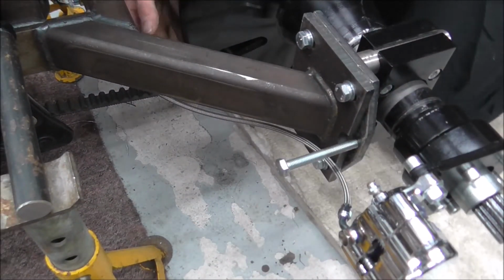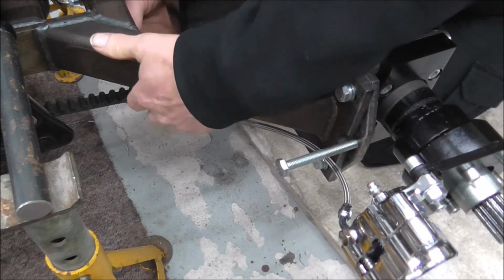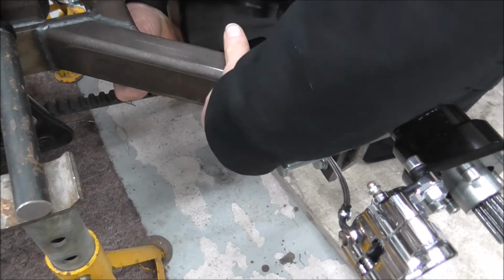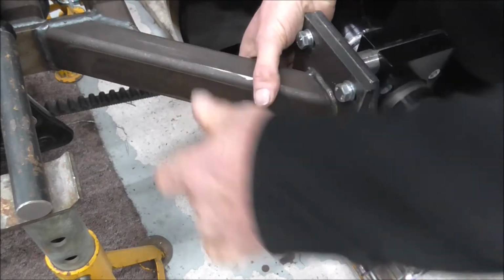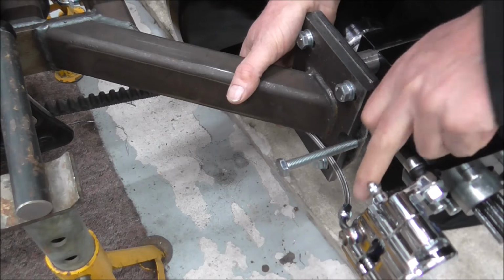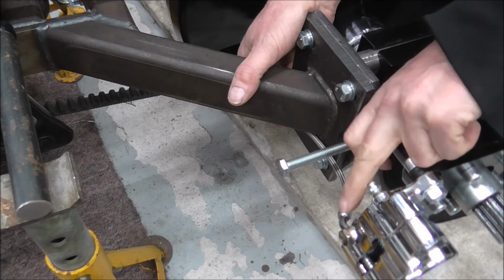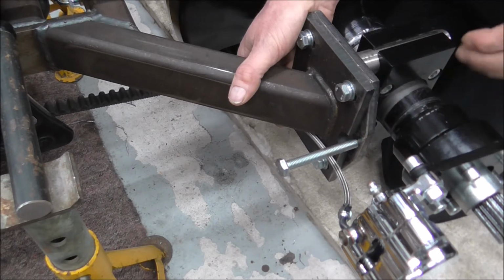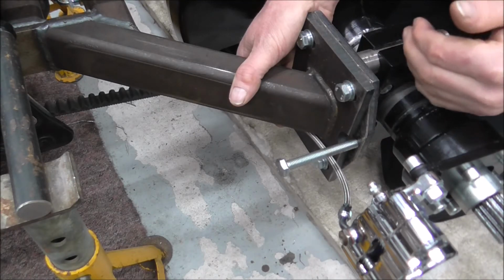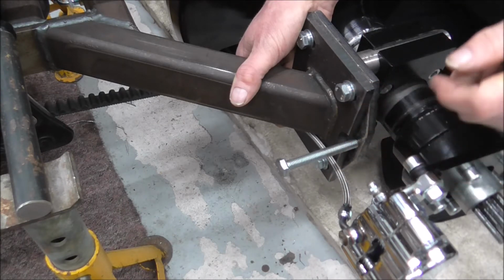So I've made up this section from the T-piece to the caliper, and basically it'll come along as I've explained, clamp up underneath with the pipe clamps, and it just nicely loops round onto this bent, so I think that's like a 45-degree banjo fitting, and bear in mind this bit doesn't move, apart from if you alter your blocks backwards and forwards. Well, there's plenty on there that will allow that to go backwards and forwards.